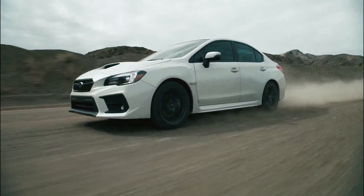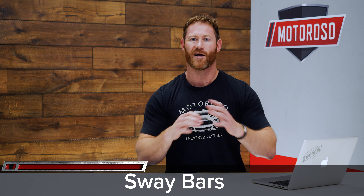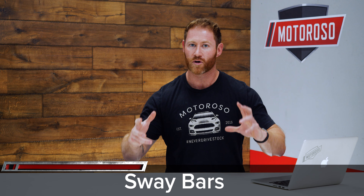It's a great platform but it does have a couple of shortcomings. The previous generations of the WRX featured the battle-tested EJ series engine, which could be tuned past 450 horsepower and take a beating. But this new FA20 engine, while great, is known to start breaking rods and bearings when tuned past 350 horsepower. It's also known to blow out throwout bearings in the clutch assembly even without aggressive tuning, and the suspension leaves quite a bit to be desired.